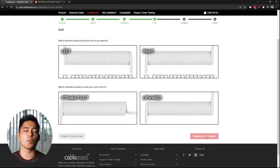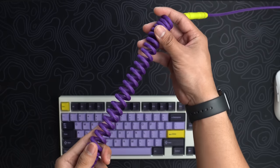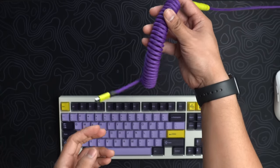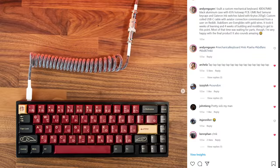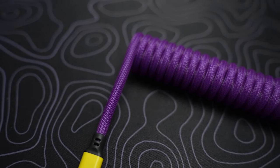For the coil, there's a handy graphic as to which orientation you want. This is going to depend on the USB port location on your keyboard and the location of your USB hub or your PC itself. Most keyboards are center or left USB, so you want the coil going to the right. Whether the coil terminates straight out or upward depends on whether you use a USB hub. I typically like the cable going to the right — I don't use a USB hub and my PC is on my right. CableMod does employ reverse coiling for the cables to make sure it's tight. If you only do a single coil, once you stretch it out hard enough it's just going to stay that way and it looks very gross. Reverse coiling takes more time, but it's one thing you want to check whether you buy from CableMod or any other vendor.